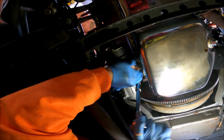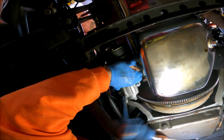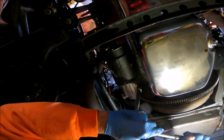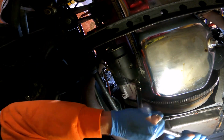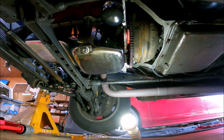I did check the alignment on the arbor and the flex plate and I had good clearances. That wasn't the issue. I didn't need any shims. I really think what happened when the engine sneezed, it kicked the starter back and it might have gotten cocked slightly. At that point I think the starter bolts were loose and things went downhill from there.